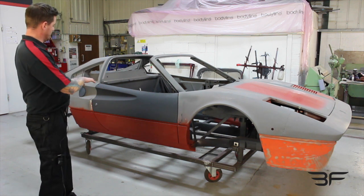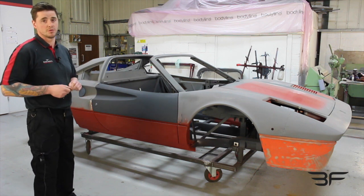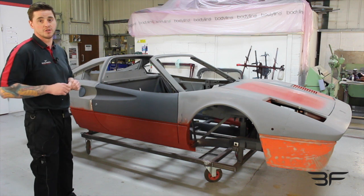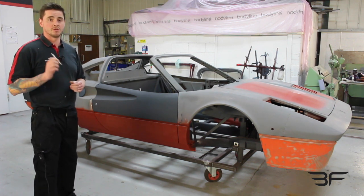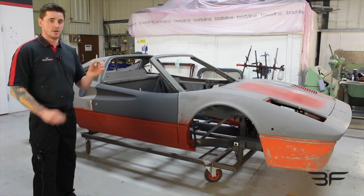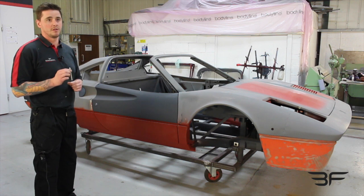So from this side it's had the complete lower half, comprising of front lower wing section, lower door skin and lower rear wing section including an outer seal. One of the benefits I was chatting about earlier was where we oversized the pins. This is one of the new pins that we have made. It comes probably about 2 millimeters bigger than the original.